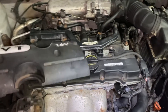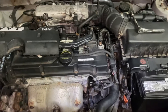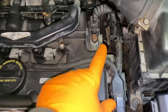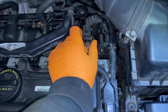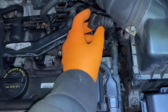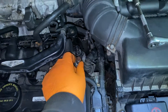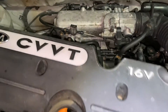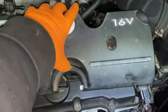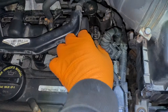All right, it looks something like this with the 1.6 — it's pretty simple to replace the sensor, it's right here. All you do is release a little slide lock over here, take that out. You're going to need a 10mm, and if this cover is in the way, these three bolts are also 10mm — just slide it out of the way because it may block access.